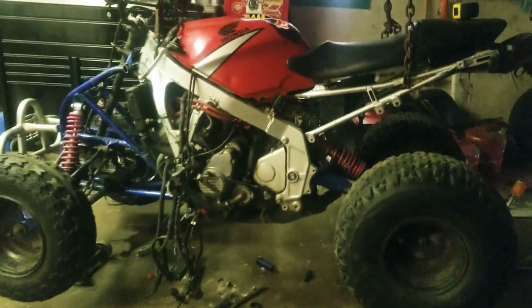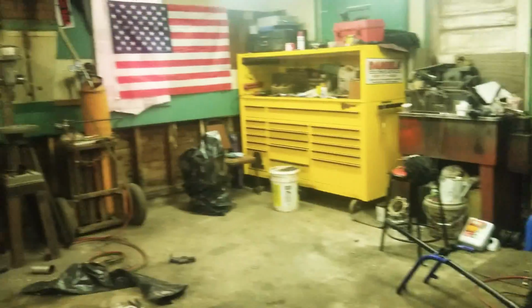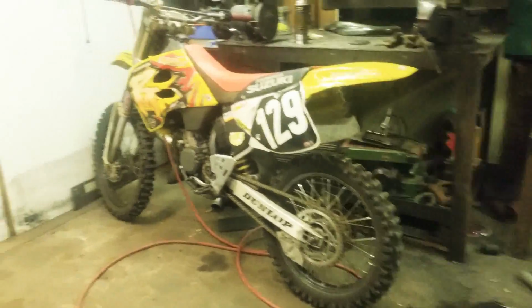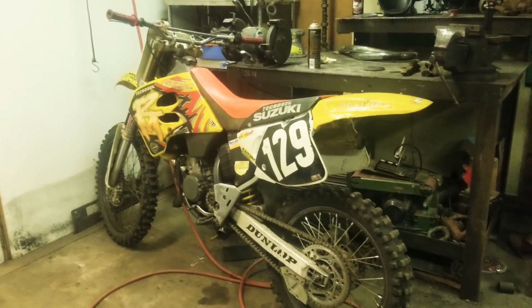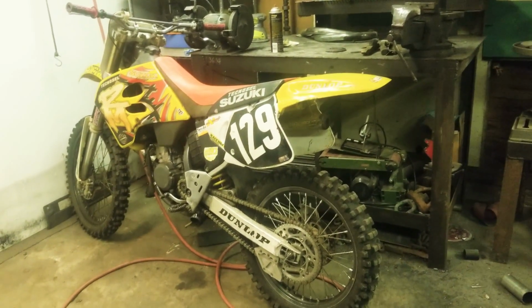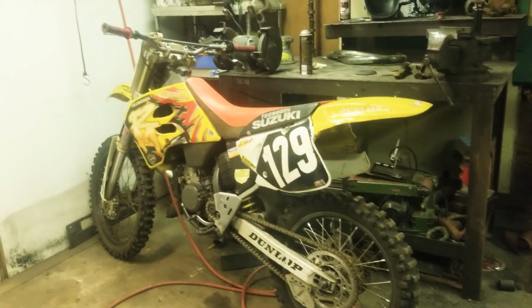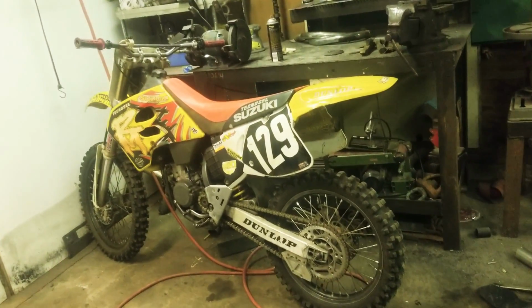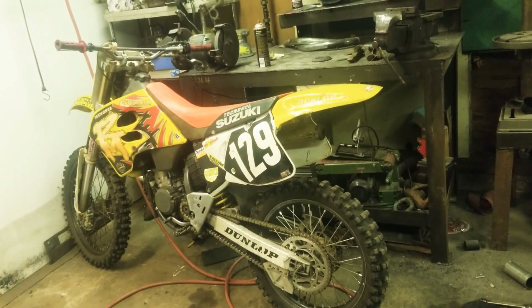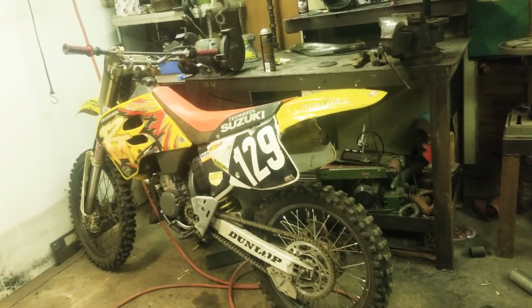I haven't posted any videos in quite a while, but this is my new shop. Got an RM125. Never done a video on that. I got it in a pretty sweet deal, actually. I needed rings, and I had an 80cc bike, an '86 XR80R that I had gotten in another barter deal. I cleaned the carb on it, put it back together, and ended up trading it for this. So I actually got something that's a little more manageable for me to ride versus an 80R. And all I had to do with this was rings, a few other little things, get it going, and she rips so far. Need to dial in the carburetor a little better.